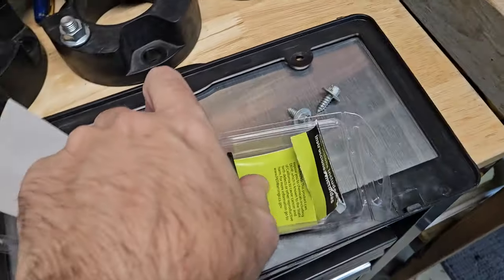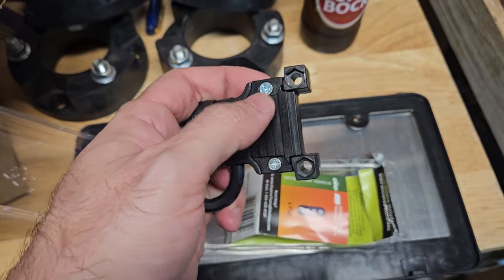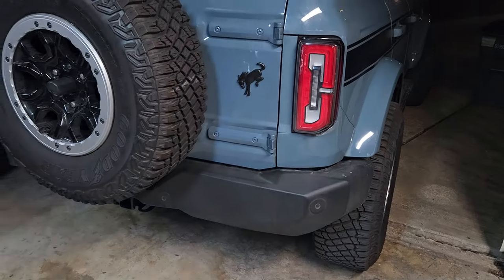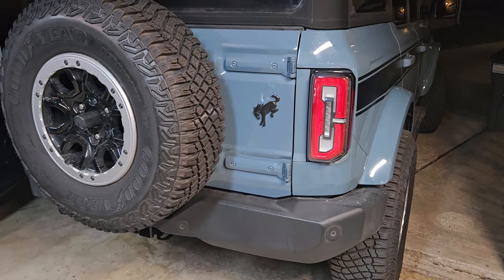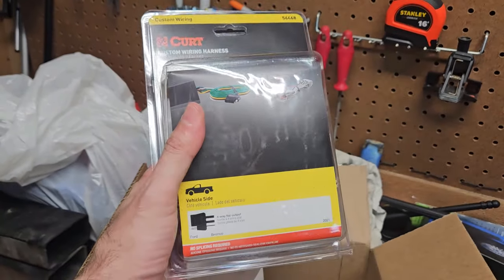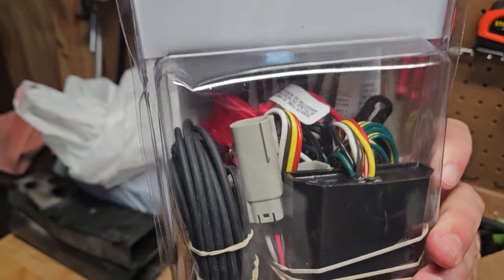All right guys, it's been a few days and I found a solution for the wiring. My first thought was to get one of these — it's a nice thick wire with the ability to plug in individual wires directly. But then I thought, because this has LEDs, I don't know if it'll work straight — it might need a little more juice since it powers trailers with halogen lights. So I bit the bullet and got this CURT plug-in adapter, which was about $75–80, and it plugs directly into the back lights.